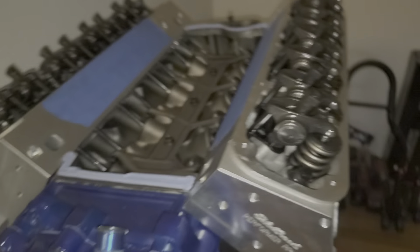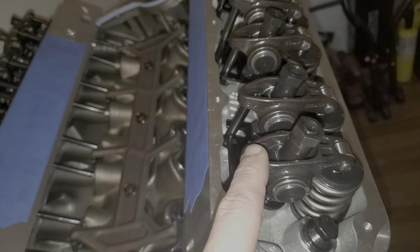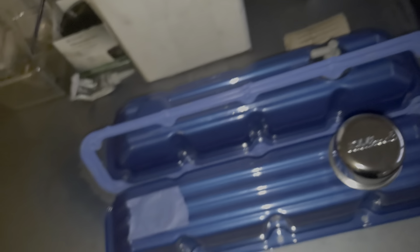For now, this is my setup. I've got the oil pan on, timing cover on, harmonic balancer on, and pulleys on. I still need to torque this down and set zero lash on the lifters, then set the preload — probably going to make a video on that. Then I'll put the valve covers on with the gaskets and all new hardware, make a video on that, then go over the ignition system, install it with the spark plugs and headers. And that's it, guys — that's the end of the 408 forged internal stroker saga. Catch you guys later.